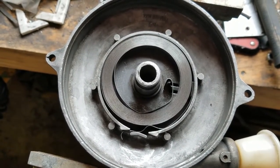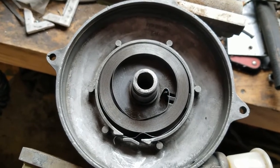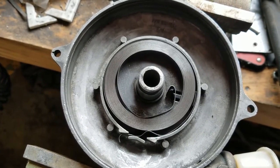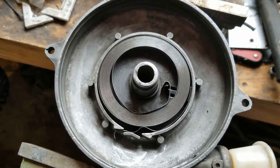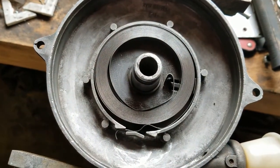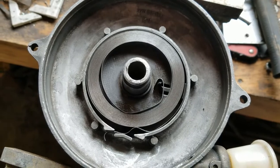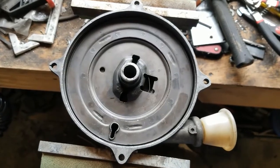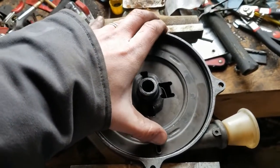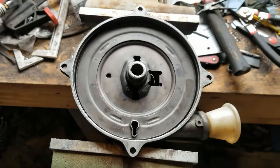How do you wind these back together? There's really no super great way. I try to find the cleanest spot I can, just let the spring totally unwind itself, and then basically start on the outside and work it in a circle layer by layer. We'll take that piece and drop it in there and make sure that hook lines up in the hook of the spring. If we can see in there — it is hooked around there. If I turn this it engages the spring and acts like I'll be able to wind it up and get recoil. I think that's going to work.